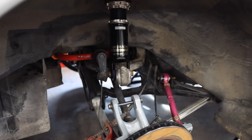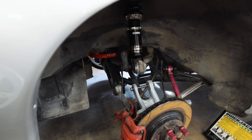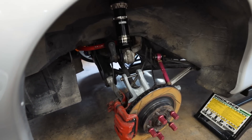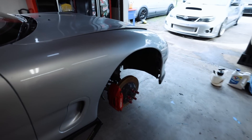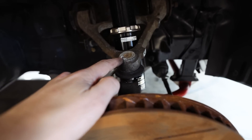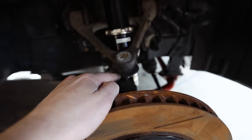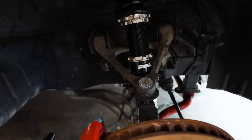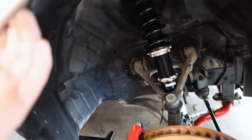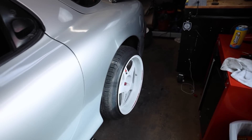Got all the coilovers in — some of them temporarily, others more permanently. This one is temporary because I'll have to pull that upper arm back out to get the new radial bearing in that connects up to the hub. The front ones are also temporarily installed because the upper control arms need to be replaced. This is the ball joint I mentioned at the beginning of the video that's non-replaceable. The lower one also looks okay, but these upper ones are shot. So we're buying complete new upper control arms — no point replacing the bushings if I'm buying brand new ones that come with new bushings.